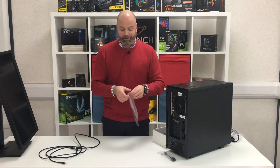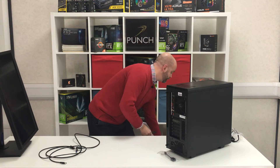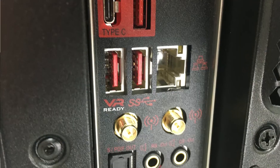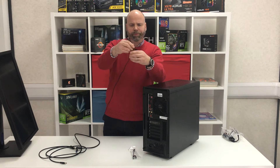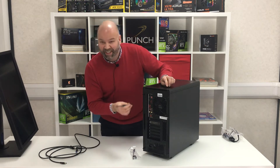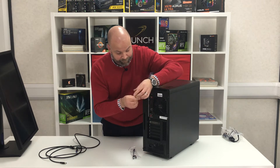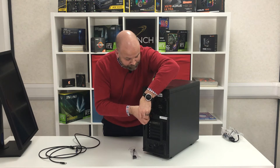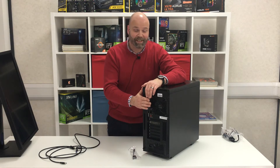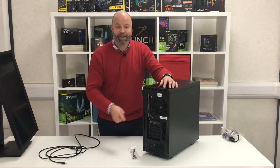However, this is a misstep that a lot of people make — your WiFi antennas. On the back of the PC, if you have a WiFi adapter fitted, you'll find these two little brass-coloured screws. If you don't put this on, you're going to get terrible to no WiFi signal at all. It makes all the difference — you would be surprised at the number of people that miss that step and end up calling us six to eight weeks in saying they're not getting very good WiFi signal. Most of the time, it's this.